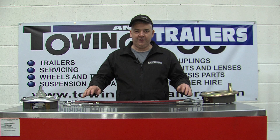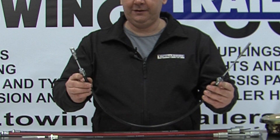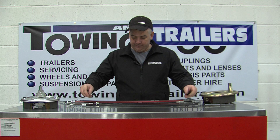There are three different ends that go into brakes that are commonly used on trailers. First of all, the oldest one, which is beginning to get obsolete, is the fixed eye cable. The fixed eye cable is, as it states, fixed onto the end of the cable, and then the outside edge pushes into the brake.